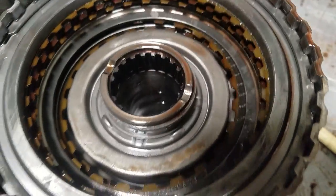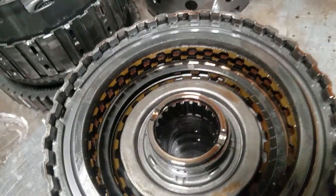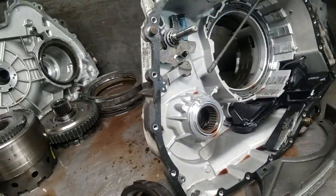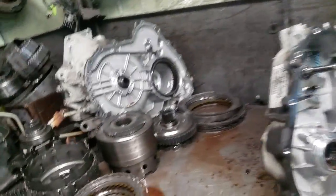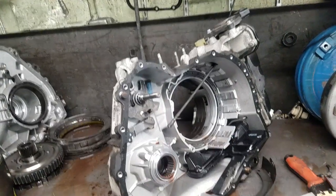This is all critical sealing surfaces on the interior of the drum. If those sealing surfaces are compromised, it may necessitate the replacement of this drum. So I think even with these parts required, we're still going to be able to save some money compared to a remanufactured transmission — although because we have the planet set, pump, and potentially this drum, it may not be as much money as we would have liked to have saved.